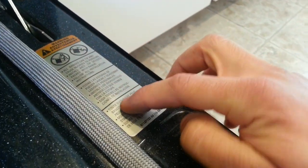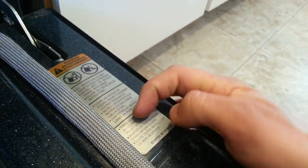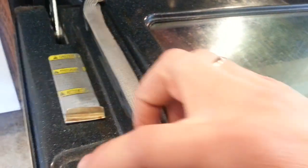Squeezing it could help, but I do recommend replacing it. Also, notice here — this hinge is actually underneath. See this bulge; it starts from right here and works its way over down to here. If we slide this back, you can see that the hinge just fits right inside of the door itself. Both hinges look like that — this door is actually bent. As we go to close the door again, it's actually lost its 90-degree angle because of the bulge, the bend right here.